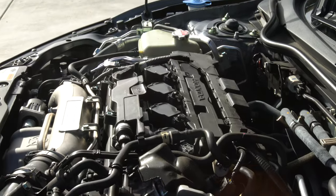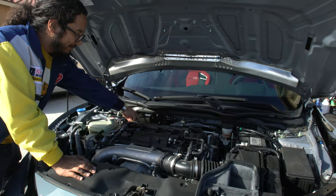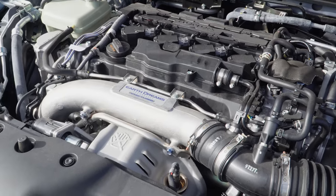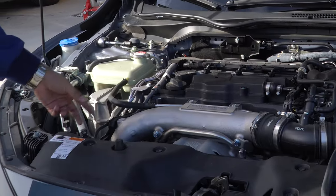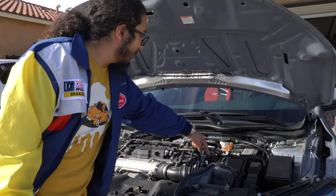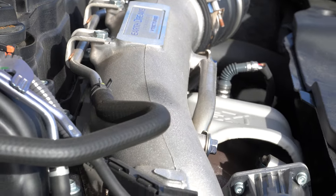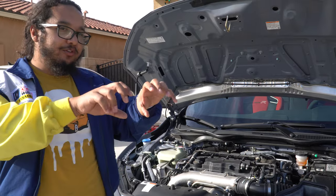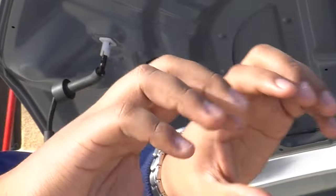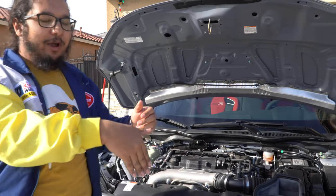It's actually shockingly different to a K20 of years past. The hot side of the engine is now in the front, and the intake is in the back. The turbo is right here. This big metal pipe is the intake tube — it's all cast, goes down into the intercooler, then back up into another cast pipe that goes into the intake manifold. They choose solid metal instead of hoses for response: a hose can expand under boost pressure and that reduces engine response, but with a solid cast piece you just ram the air straight into the engine.